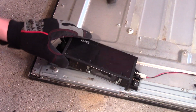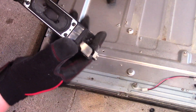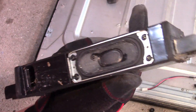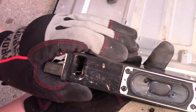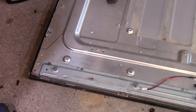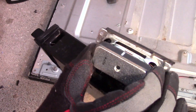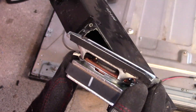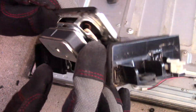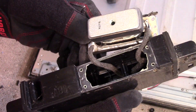Here's the speaker. It's not even screwed in. Here's the connector. It's just a cheap little speaker — it doesn't even really have a tweeter. Could have easily put a tweeter in right there, but I guess not since it's such a cheap TV. You can see it's got a square magnet, just so it takes up less space in the TV. It's got an oval voice coil, and the terminals are on each side, which is kind of weird. I'm sure that's to save space too, so they can make the little enclosure slimmer.